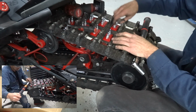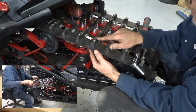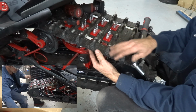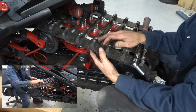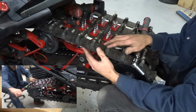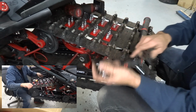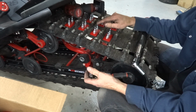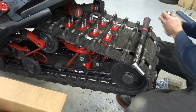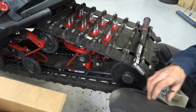So this is a 1 1/4 inch track. It's an Ice Ripper. Okay, I already have the ice studs from the factory, but this is not aggressive at all. I have a 900 Turbo Stage 2, and I want to have more traction. Okay, I'm studding 192 with the 450. I'm actually going to have about 1/2 inch penetration, almost.